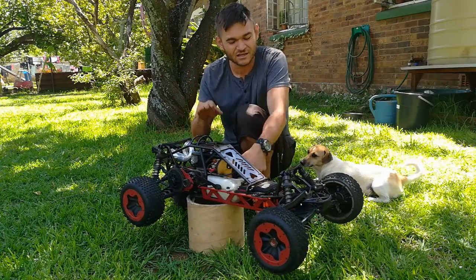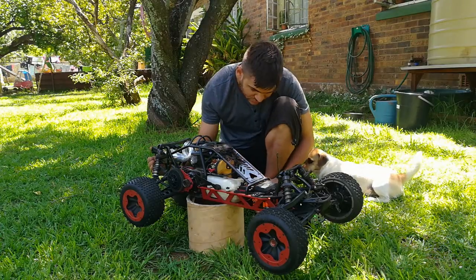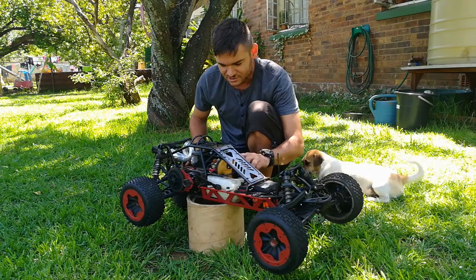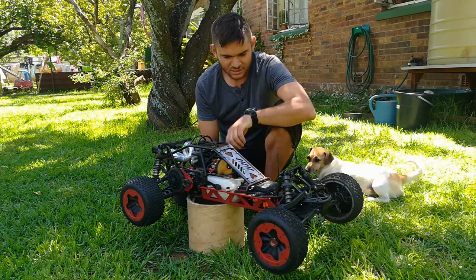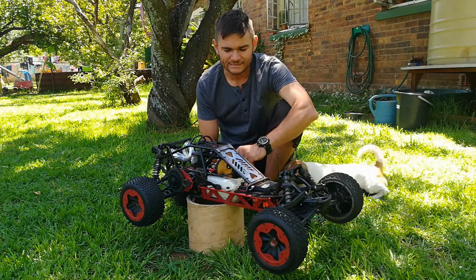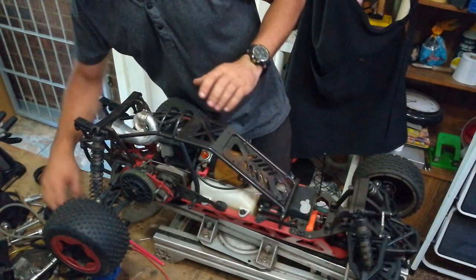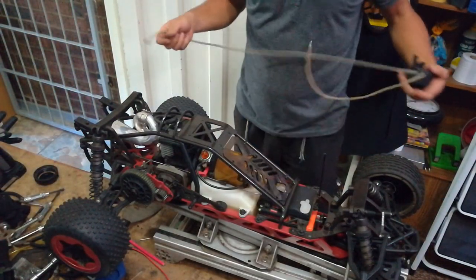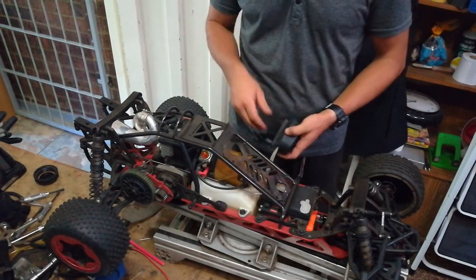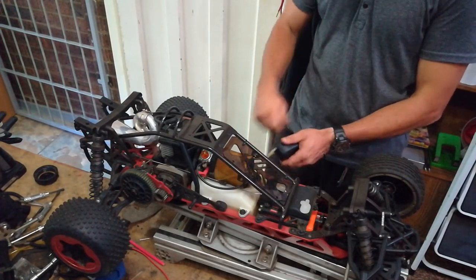You hear that irregular idling, and at the top end it kind of still screams, but I'm getting no smoke from this car. So I wonder if this is pure fuel in here with no oil, and that the ring has actually worn out. I'm going to swap out the fuel and see if it makes a difference. If it still runs the same then we know it's internal. I'm going to use my little fuel suction thing here — I did ask Delon if it's possible that this could be pure fuel with no oil. I'm just pumping it out here into a jerry can.